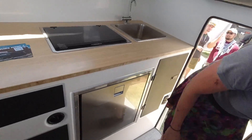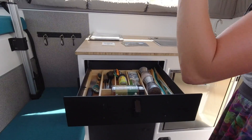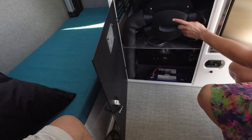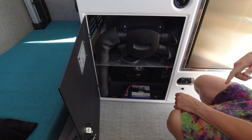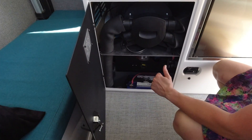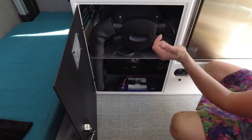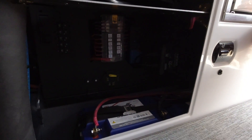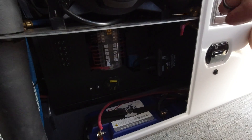There's a kitchen cutlery pullout drawer here with all your food gear organized inside. Electronics are in here too — we've got the Truma Combi Eco Plus unit, which we're testing so you can run it off propane or electric. We're now partnering with Battle Born for our lithium batteries out of Nevada — great customer service, really high quality batteries made in the United States. All Victron components. We upgraded our electrical box so it's much larger, and all linear actuators are on a circuit breaker instead of fuses, so if anything happens you can just push the button.